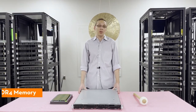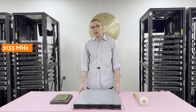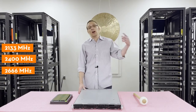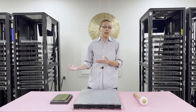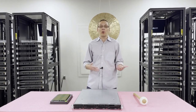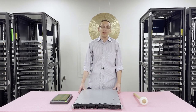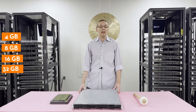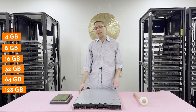As far as RAM is concerned, it's a DDR4 machine. There are 16 DIMM slots inside. There are a number of different speeds you can use: 2133, 2400, or 2666. I will note, though, if you're using 2666, it's going to clock back down to 2400. So if you're buying right now and you have to choose, get the 2400 speed because it's going to be cheaper. As far as different sizes, you can go as low as 4GB, 8GB, 16GB, 32GB, 64GB, or all the way up to 128GB.